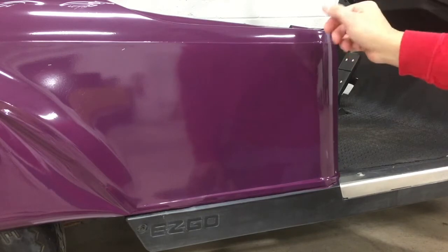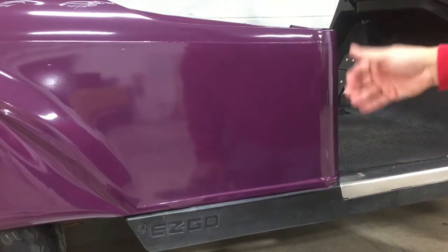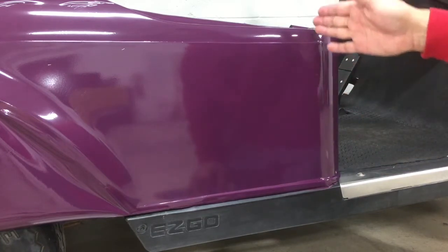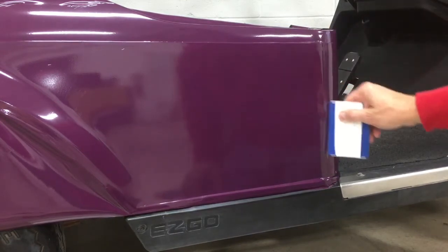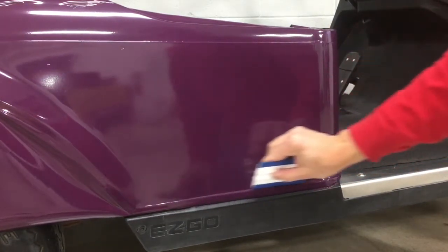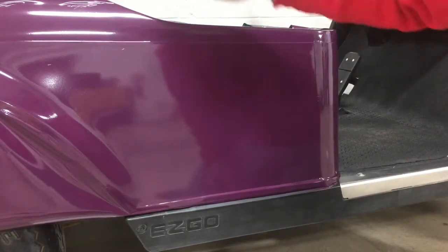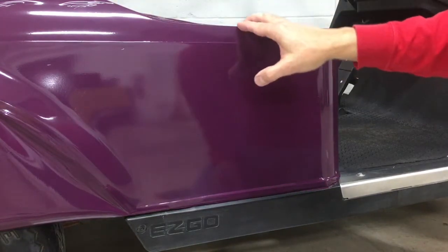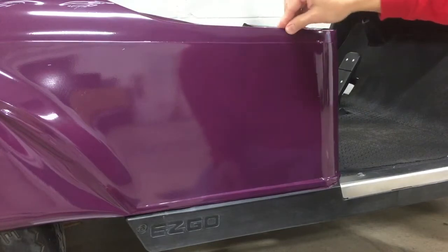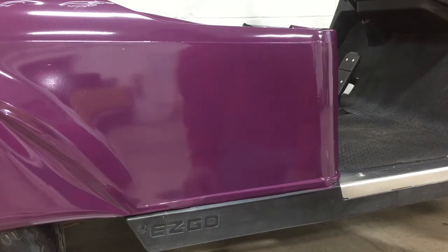Because you've straightened your edge and had a straight edge with your overlap, there's really not much more you need to do. If you wanted to, you could take your blade and recut another straight line, but for most installs this is going to be certainly sufficient. Then you would just work on the back side — your seat is going to cover all this up, so this area up inside doesn't really have to be that pretty. If you get up and over the curve so all the green is covered, then trim on the back side — you're fine. You're not going to see that as a finished product.